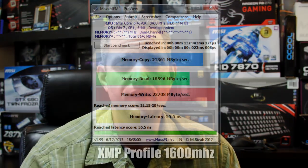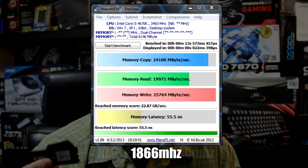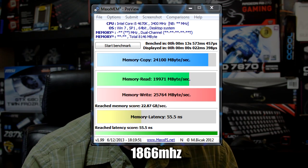That's a lot. I can't even get my Corsair Vengeance to boot at 2,200, let alone 2,400. These passed my stability test at 2,200. Granted, you have to relax the timings quite a bit when you overclock RAM that far, but the bottom line is it was stable and it was fast. I'll be putting up some images showing the benchmarking scores through MemTest and MaxMem on how well these modules did.